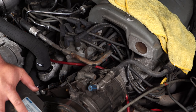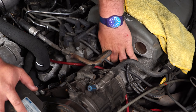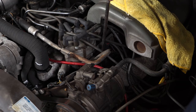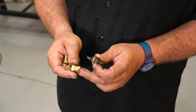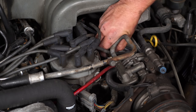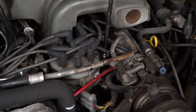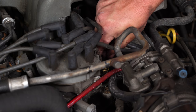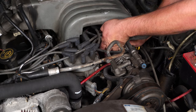Now we're in with the wires, so we're going to make the connections and install the supplied sensors. The coolant sensor is going to go right here - pop this cap off, set the factory wiring aside, and remove the sensor. Once you remove your sensor, figure out the correct adapter, as several ones are included. Line it up, make sure it's the right size, then install some Teflon tape and install it in the factory location. With the adapter installed, we can install the coolant sensor itself. With the sensor installed, fish the harness over and plug it in.